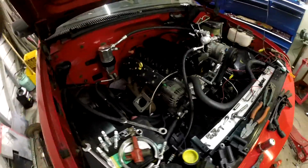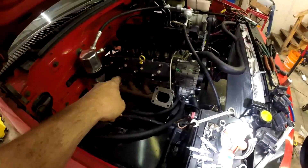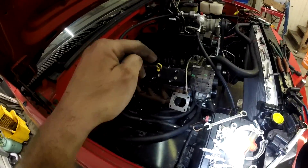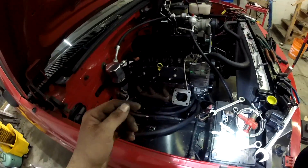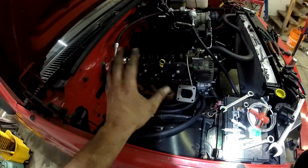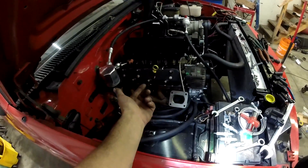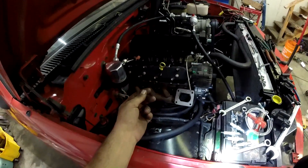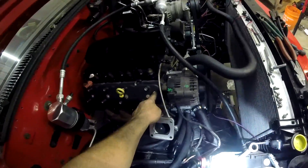I've got a few key things done. Show me the dipstick down there. From me bending the dipstick to fit in this space, it shortened up a little bit, which means the o-ring on the little flange didn't seat all the way into the block. So I put a bunch of gray Ultra Gray silicone on about an inch further down and when I put this in I went very carefully. Now it's where it needs to be. The dipstick is a little higher, so the full line would actually read as overfull — but it's a Chevy, I don't think it'll care. I also swapped these valve covers around.